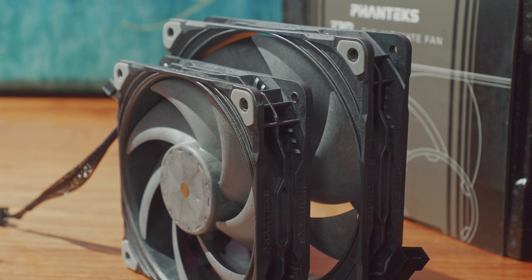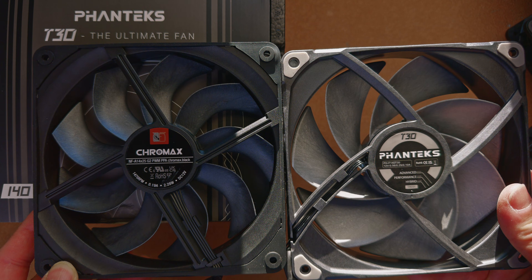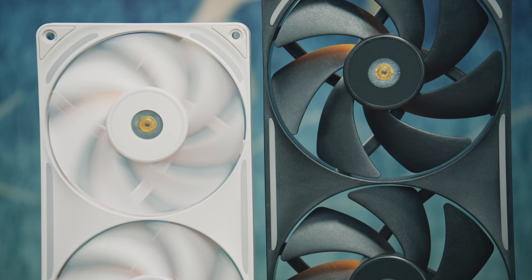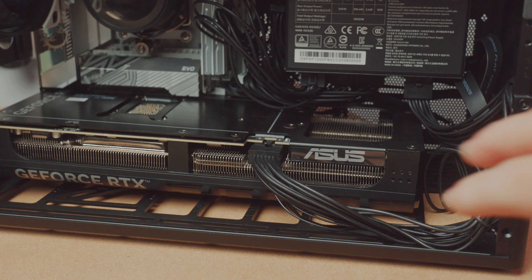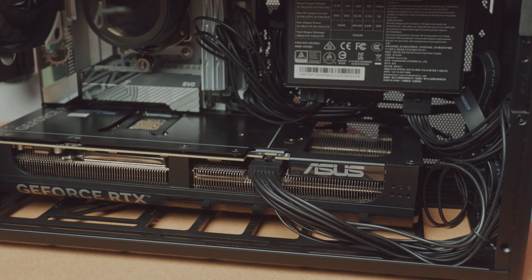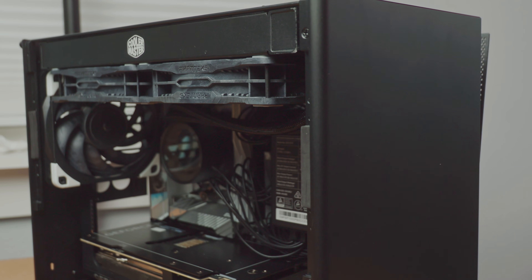To test whether this is the best 140mm fan, I'm comparing against three other high-end models: the regular-thickness Noctua A14G2, the recently released NZXT F280X — a single-frame 280mm unit also in the 30mm thick category — and the regular-thickness Be Quiet Silent Wings 4 Pro. All testing is noise-normalized, meaning measured sound level is identical in each grouping, except for the maximum RPM test. The test uses a 280mm AIO with a Ryzen 9 9950X loaded to 200 watts.